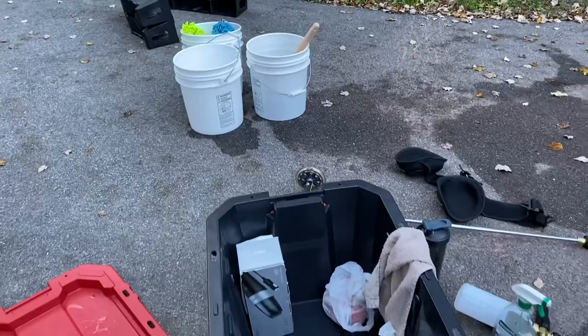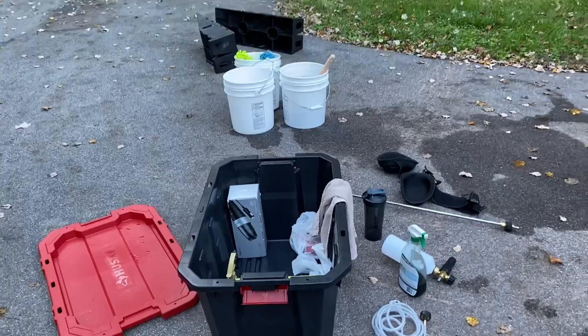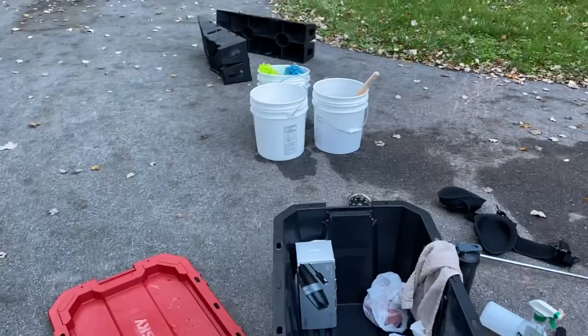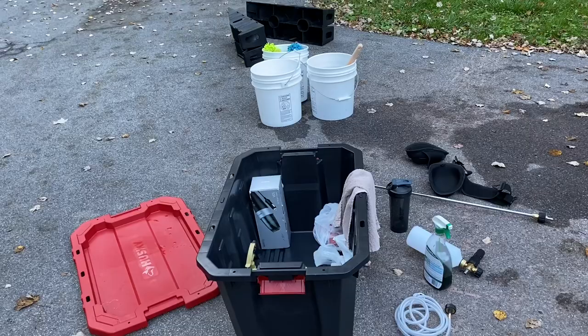You know, the automated car washes, they don't really take care of the water the way you think they might. A lot of them are not filtering out for salt. So you don't know if you want high pressure salts going into places like lights and gaskets and electronics, where salt does not belong. And the brushes that they use in a lot of those automated car washes are not washed properly. There's grit and rocks and dirt and mud that's just rubbing against the paint, and it's gonna mar the clear coat. But when you do it by hand, you get that nice finish.